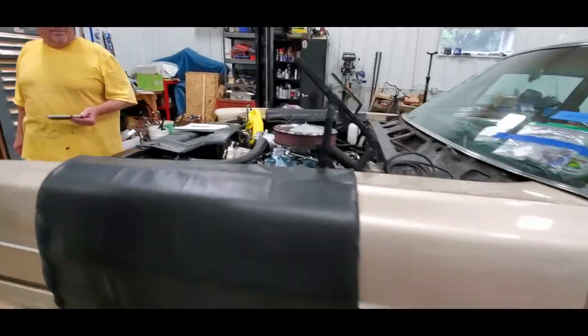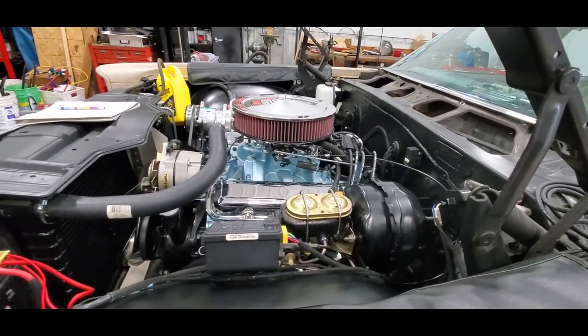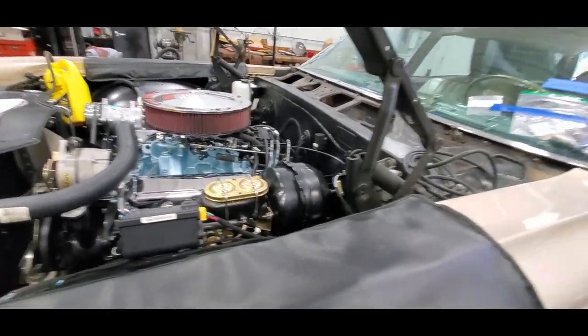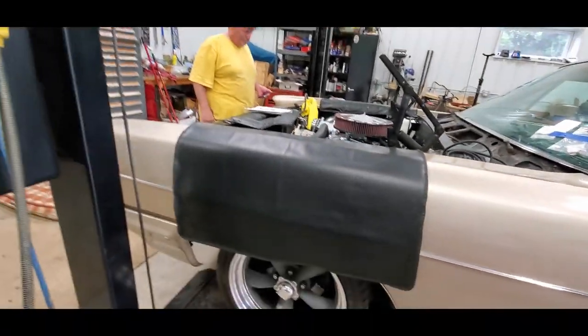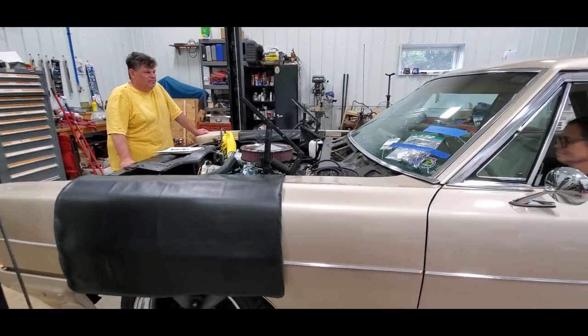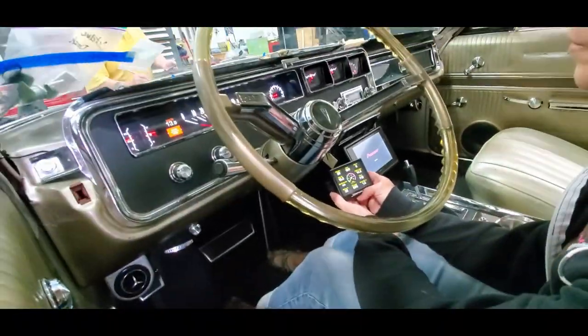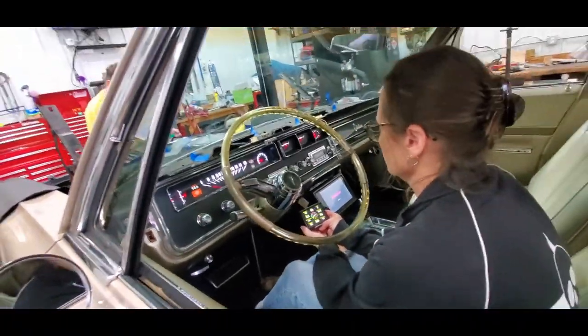That is unburned hydrocarbons. ShopDog's not even around. That was strange. That was very strange. So that was what happened that very first time. How come I can never seem to have the phone on when that happens? The car restarted just fine. You can see the IAC at 22 now. We're hanging at 650.